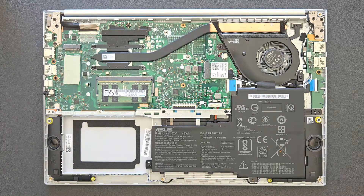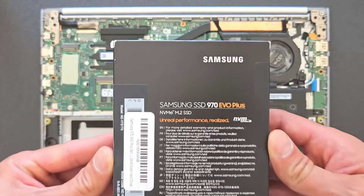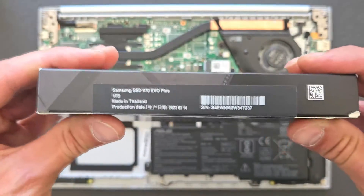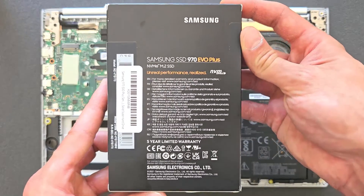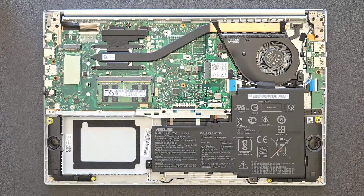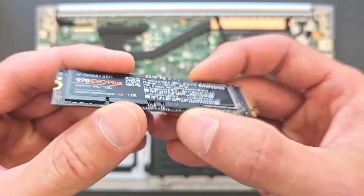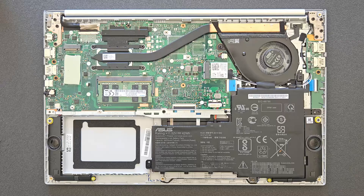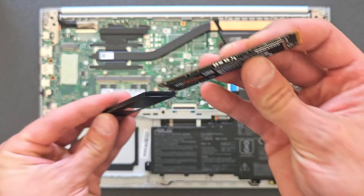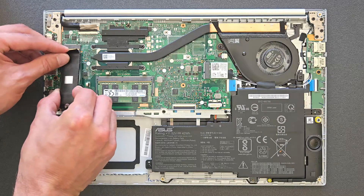What I'm gonna install now is a Samsung one terabyte. I'll leave the link in the description so you can go and purchase one — it is guaranteed to be working with this laptop. Later on we're gonna boot into Windows and you'll see the new specs as well, so you know I'm not fooling anyone. That's how it looks — Samsung 970 EVO Plus one terabyte. Great drives, pretty cheap as well. I've used them many many times before so I can recommend them. Slide it into the slot, install the drive back, and don't forget the screw.